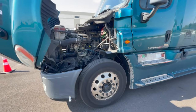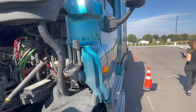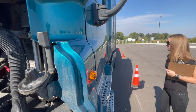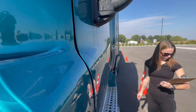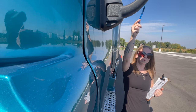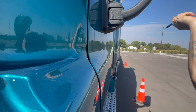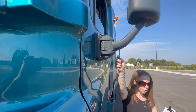The lenses for the side of the vehicle and the side of the trailer are properly mounted and secured. They're not cracked or broken. They are clean, they're not missing, and they are in the proper color of amber. I have no camera for the rear side of this vehicle. My mirrors are clean and they are not cracked or broken. My mirror brackets are properly mounted and secured. They're not cracked, bent, or broken, and there are no missing parts.